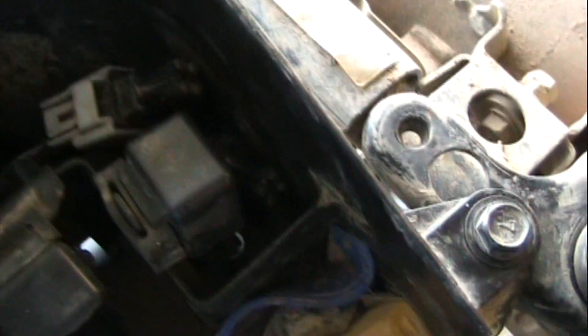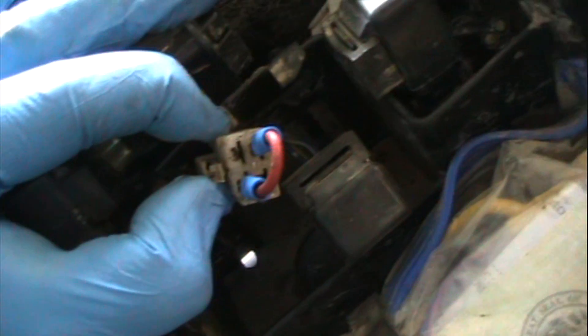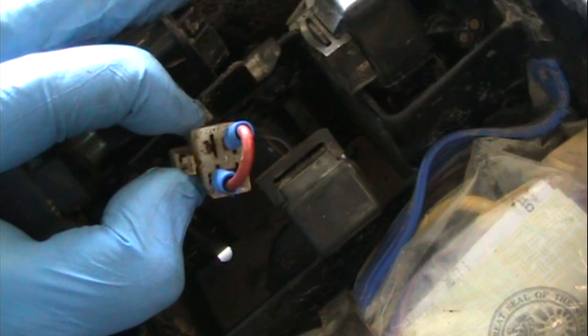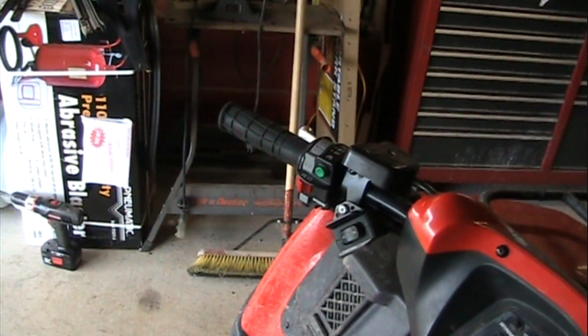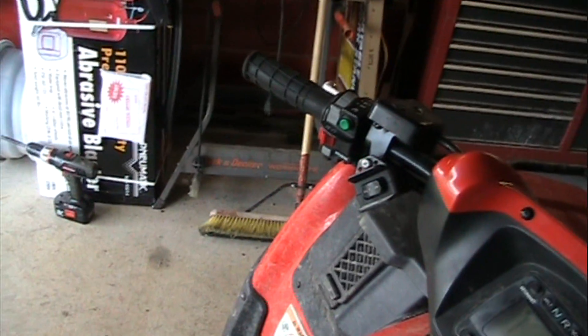What I did is — get a little close up here — I jumpered the fuel pump relay. I jumpered from white-red to yellow-red. Here's an easier angle: looking towards the back of the machine, you've got the tab on the left, CDI corner, lower left to upper right. What that does is it allows for turning on the ignition and using the stop-run switch as the fuel pump switch also, so it just ties into that.